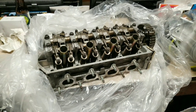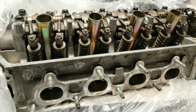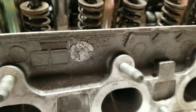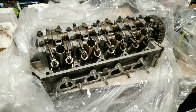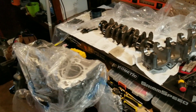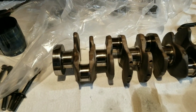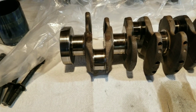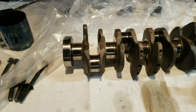I knew nothing about the head or what to look for until I did more research. I had this thing all machined up with money into it. Sure enough, P071-1 is the stamp for the D15Z1 head, which means it was built for fuel efficiency and is not going to make any power. I'm going to have to sell it and pick up a D16Z6 head. The connecting rod journals on this engine are 45 millimeters in diameter, while the JDM D15B has 48-millimeter journals — that's why they were so loose.